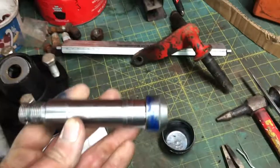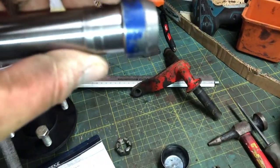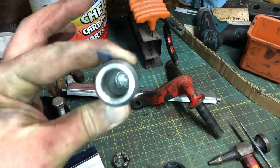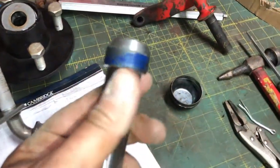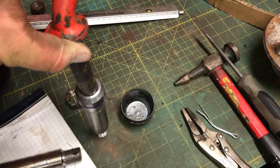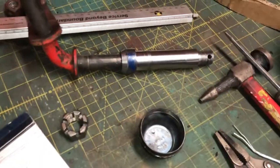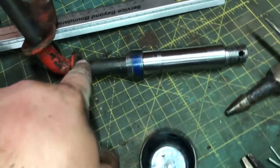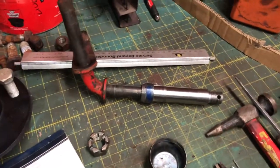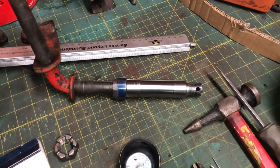We're back — just got this fresh off the lathe. There's the finished product. Got a pretty good chamfer on the end there. It leaves a little bit of room — a few more where the seal rides when we weld, but should be plenty. You can see it's bored out. Not the smoothest finish — if you really wanted to get precise you could use a three quarter reamer, but it's fine for this application. It's pretty tight on here; I'll have to put heat on it to get it to go on all the way. Once we get that on, we can weld it right around this washer — I'll have to clean it up of course — and it'll look just like this one. So that'll be both sides done. That's how you upgrade the front spindles on your garden tractor on the cheap. And if you don't have a lathe, you can just take it to a shop — they can do it probably in half an hour or so. Easy peasy.